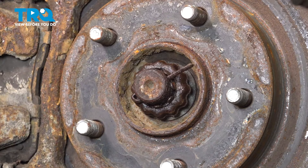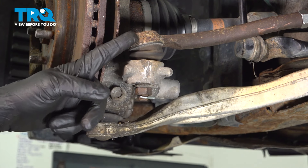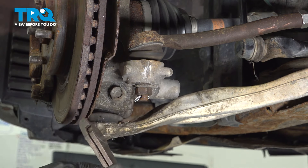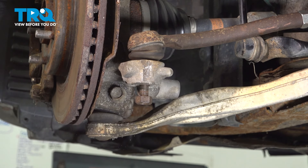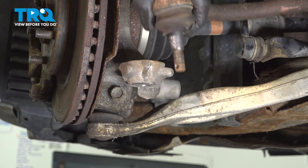Once you have movement in this area, you can continue. Now let's have a look along the backside of the rotor. We're going to be looking for where the outer tie rod end connects to the steering knuckle. Remove the locking cotter pin and then your 19mm mounting nut. When you remove that, you'll find that it also had a washer. Now we can start the nut on there just a couple of threads. We'll use a hammer to cause some vibration and that should break this free. When doing so, be extremely careful not to cause any damage to the outer tie rod end. Set this aside.